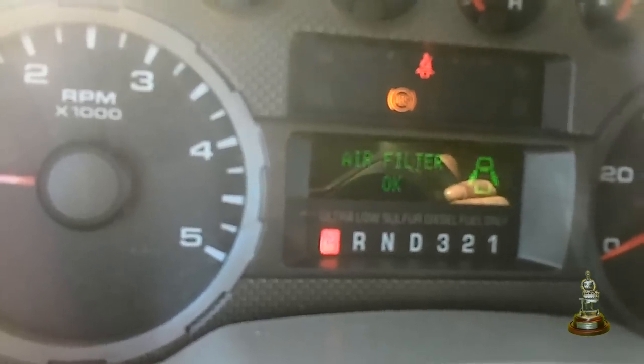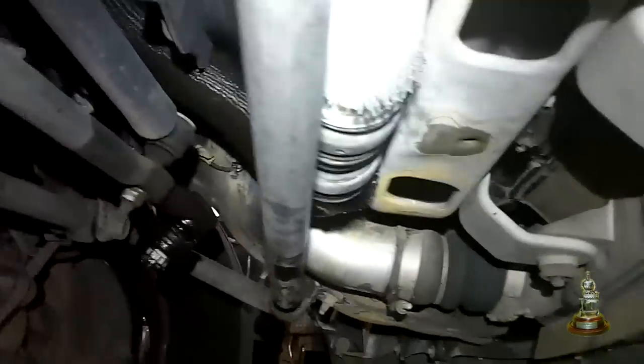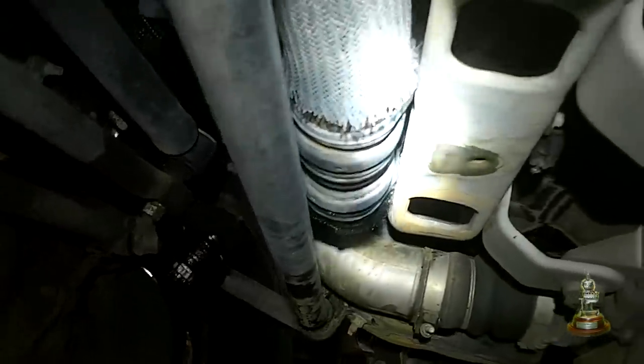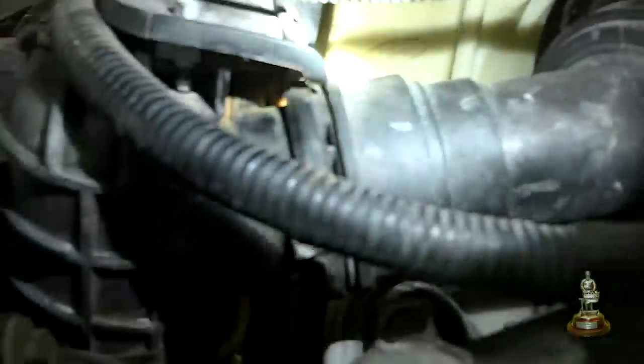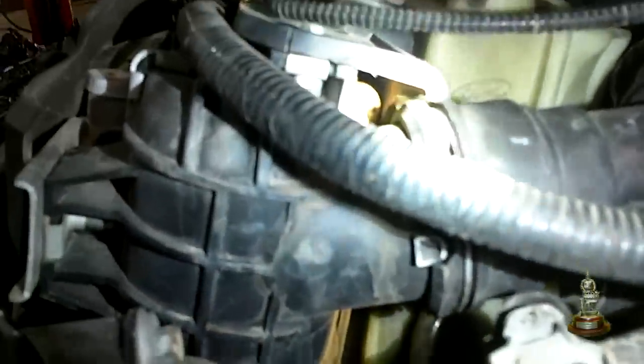This truck has 4,503 hours. We can tell that the coolant leak is from the lower radiator hose where it connects to the water pump. But you also want to inspect your radiator. As you can tell by this radiator, the cooling system was in pretty bad shape to begin with — a lot of rust residue left over. The entire end cap of this radiator is leaking. Most of the time you'll find the end that's leaking down near the bottom; look through the fender well and you can see it there.